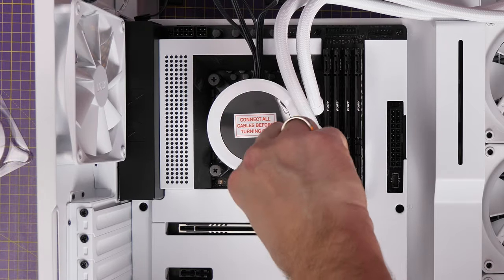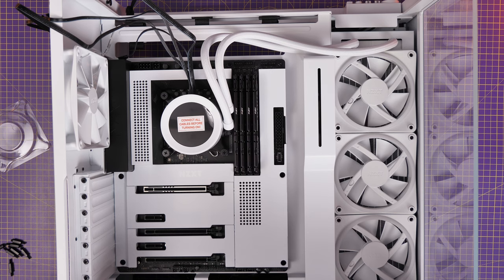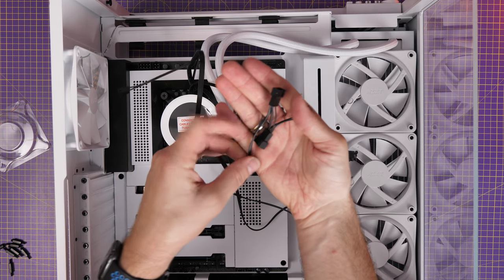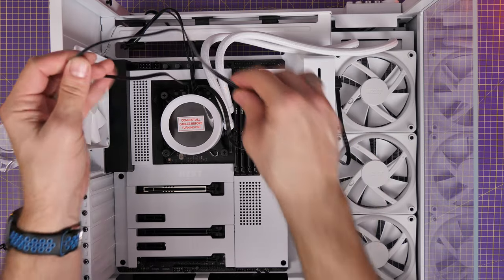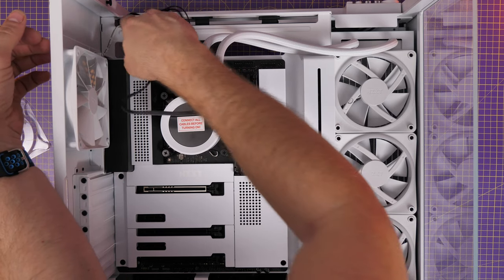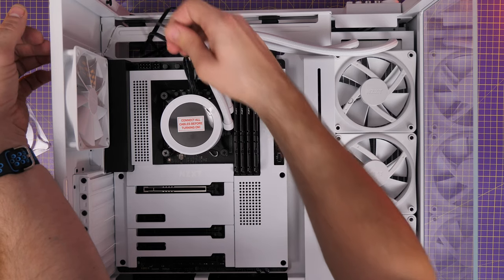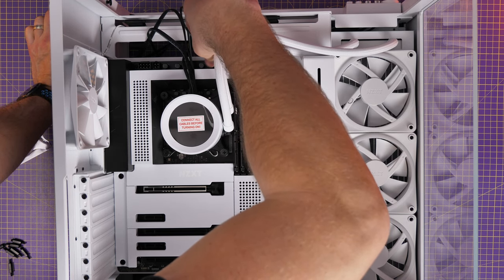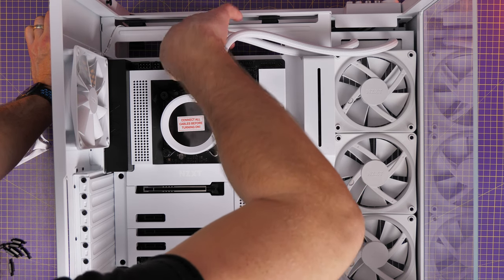Use a screwdriver gently to screw those down. The breakout cable that runs to the rear has those three fan connections — don't forget to plug those in for fan power. There's also a flat SATA connector from the PSU, an RGB connection (not needed here), and a USB connector which you do need. Push those fan and other cables through to the rear — you can use a cable tie to tidy the black cables up, and running them through to the back keeps things neat.